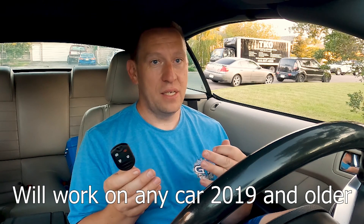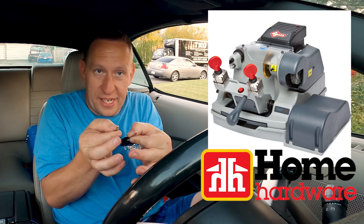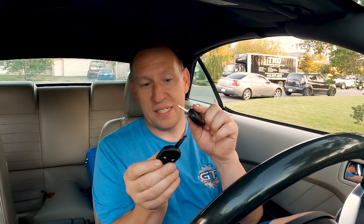I have purchased a key which is a factory replacement from Amazon — I'll put a link in the description. What I'm about to show you will work on any car from about 2019 and older. This key comes uncut; it's currently cut because I took it to my local hardware store. In Canada I've had the most success going to Home Hardware — they still have the old machine that clamps and traces the key. Newer machines like Walmart's may not cut it, because they check for a chip and say vibration can damage it — and it can. I have programmed hundreds of keys and have seen damaged chips.